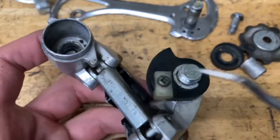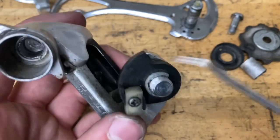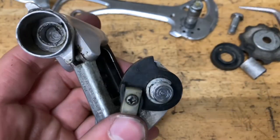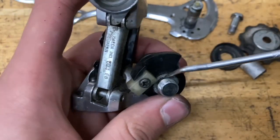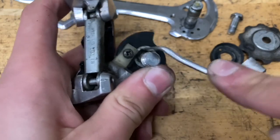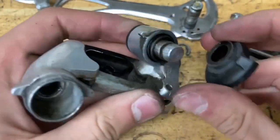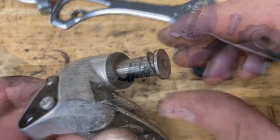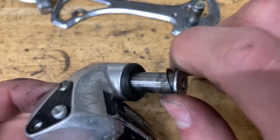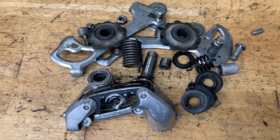And now for the Pinnacle, you don't have to take this off. You don't have to take off this little screw. It's not going to really help you in any way, just a stopper for when you put it on the bike. So yeah, grab your pick and then pop off this little clip here. Just pull back, it should spring out. There you go. Could be kind of tight, then slide out your bolt. All right, and now everything's all nice and taken apart.